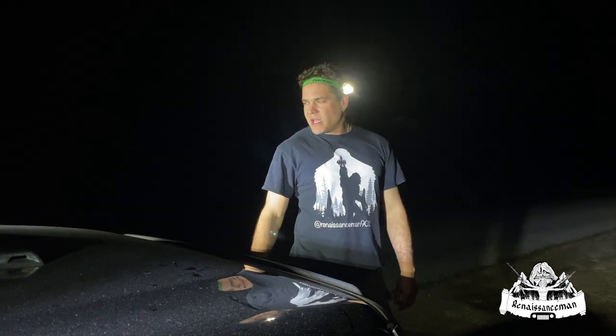Hope you guys enjoyed that LED cube light install with the DV8 mount. We showed you guys how to wire it to auxiliary switch four, which is a 15 amp. All these lights in total are running about 13 amps, so we're just under — we should be good. We'll keep you posted if anything happens, but I'm 100% positive we'll be just fine. Hope you enjoyed the video — cheers for now!